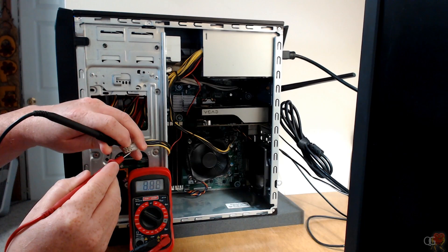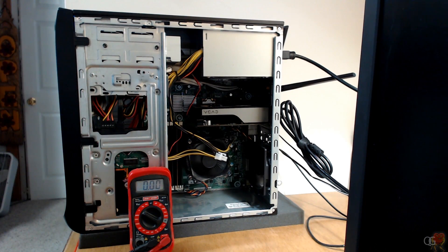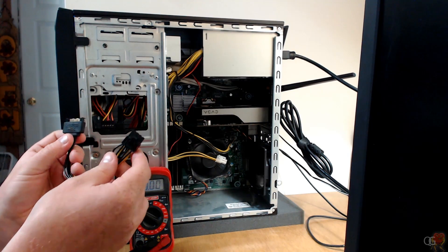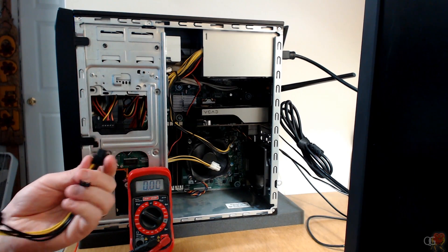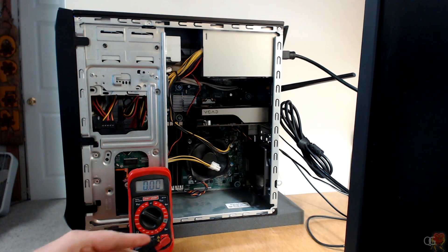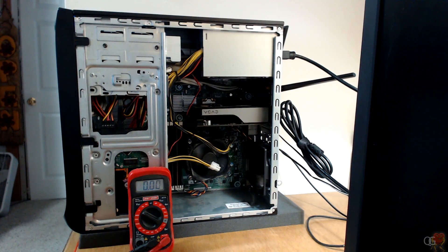So the 6-pin connector basically just gets its power from several wires — not sure exactly why, but feel free to comment. This cable must utilize the 12-volt power rail and just omits the 5V and 3.3V. So it seems like it would work, definitely on a card with a 6-pin. And that's all we're testing today because that's the only type of graphics card I have.